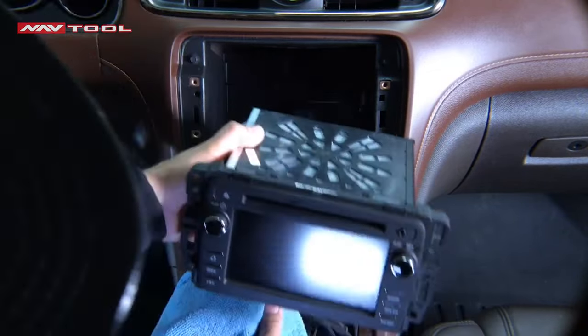Testing vehicle after reassembly. Before starting the interface, adjust the radio settings. Click Next. Click Next. Click Settings. Click Display. Click Rear Camera and uncheck both boxes. Screen menus and settings may look different depending on vehicle.